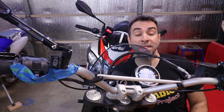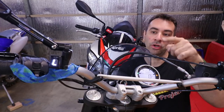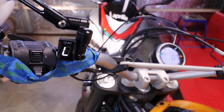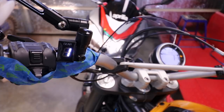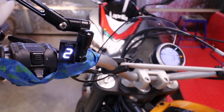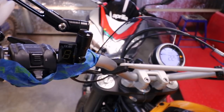Yeah, it seems like I got all the wires the way they're supposed to be. I'm gonna button everything up and then we're gonna do the learning sequence for the gear indicator. Turn on the ignition — the display is gonna count down from six to one, then 'L' is gonna be blinking. Start the bike. At this point, in neutral, make sure the bike is on a proper stand that will not collapse. When the display shows first gear, engage first gear and run the RPM above idle. Once first gear is learned, the display will move on to the next gear — shift to second, run the RPM up, and so on for third, fourth, fifth, and sixth gear.